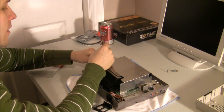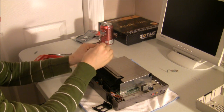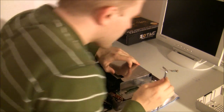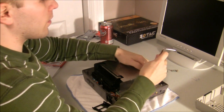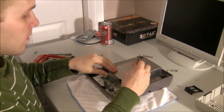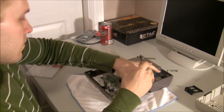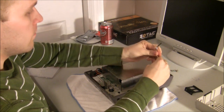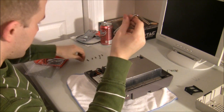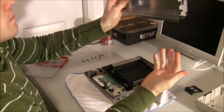The other nice thing about the Nintendo system is the majority of the screws — the six screws I took off the back and the screws on the shield — they're all the same size, so you don't have to worry too much about knowing what those were. There are two more on the back here. Here's the front controller connector piece I took off earlier. Now that heat shield comes right off.